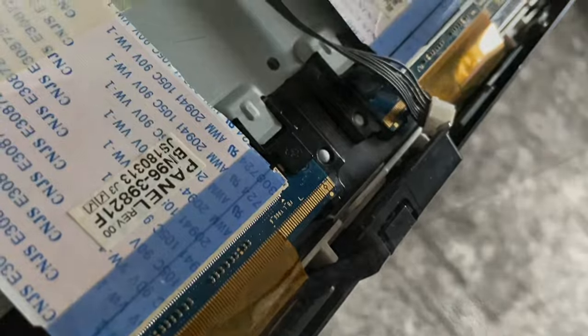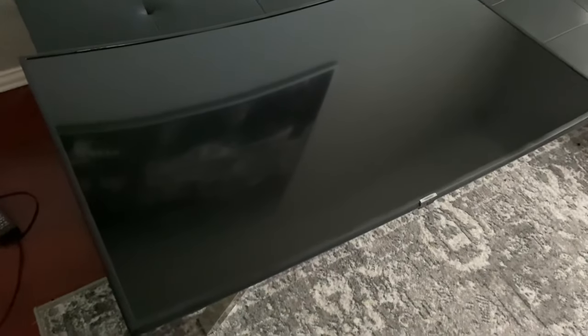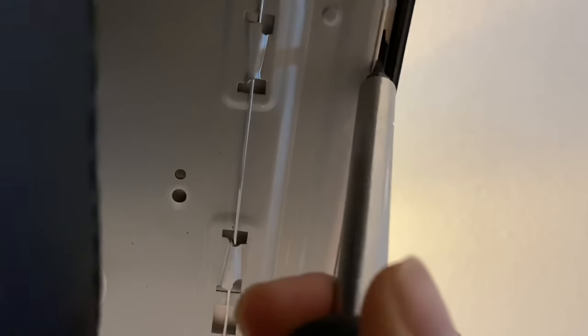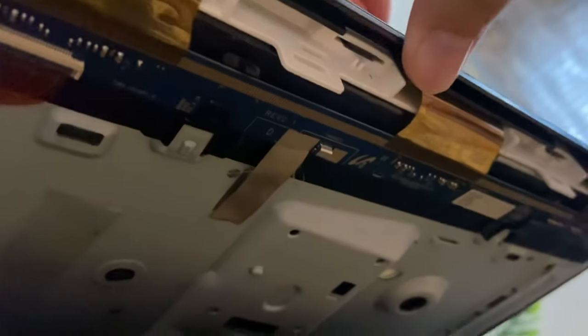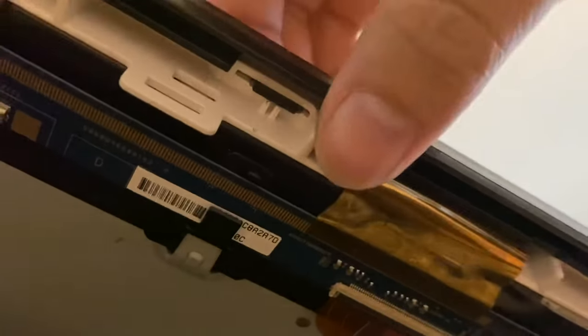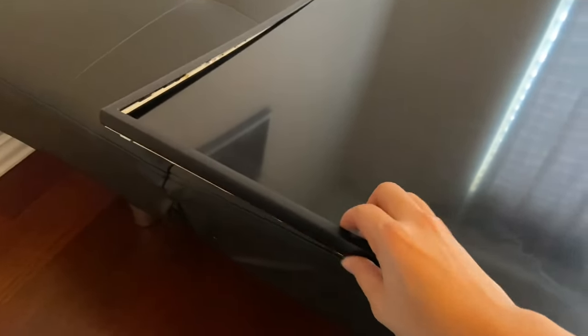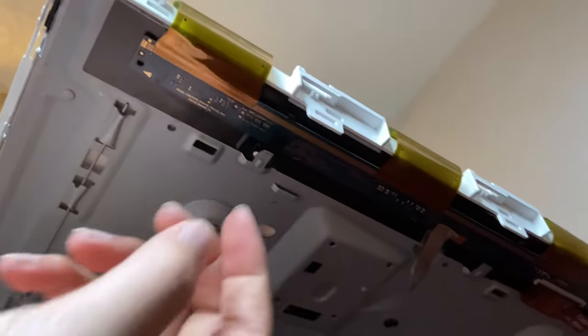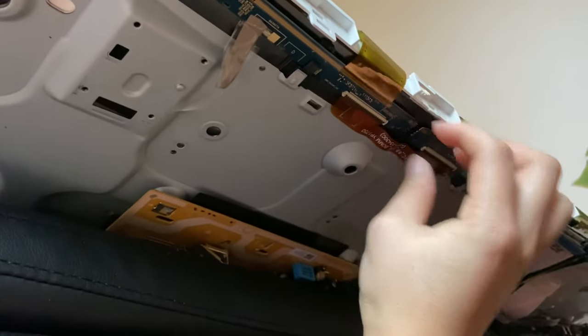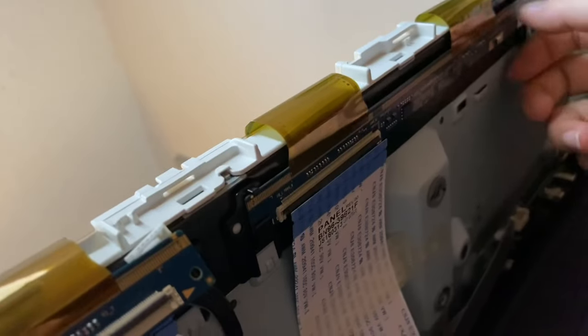Remove this plug from the front too. Now I flip the panel back over — I still have the board on the back of the TV. Now I'm facing up where we have these plastic tabs in gray color, which we have to pry out just slightly and then push that gray plastic bezel upward. With that action done, we're able to fully remove this plastic bezel. These boards come out very easily — just make sure you don't damage the ribbon cable, so pull it out carefully. We lift just lightly and then pull it out towards the bottom of the panel.